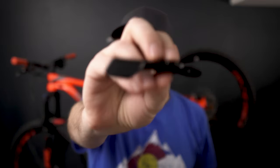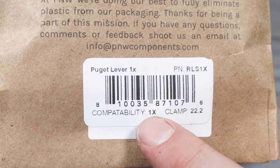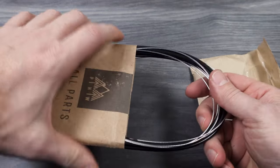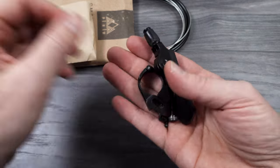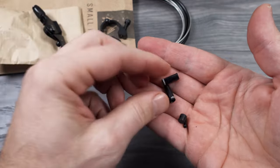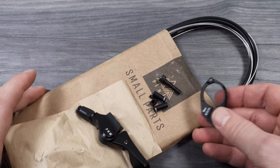In the intro I referred to this bag as being a little gem — I was referring to the Puget remote, the cheapest remote that they have. They use the same name for the 2x, and I believe the combination of this and the Wolf Tooth remote gave birth to version 2 of the Loam remote. For this budget option you get a small parts bag with the Puget lever, a part number, a 1x and 22.2mm clamp. As opposed to the other two remotes, this comes with an inner cable, an outer cable, and all the little parts you need to terminate the cable — the bar clamp, the lever, everything. From a value standpoint I would definitely consider this the best out of the three.